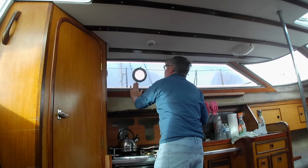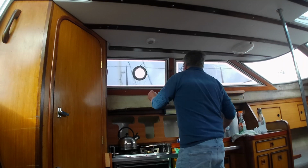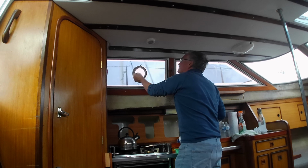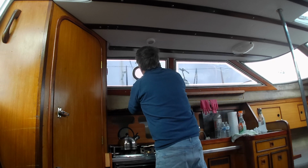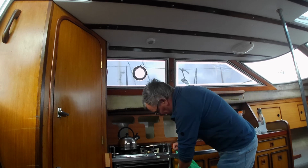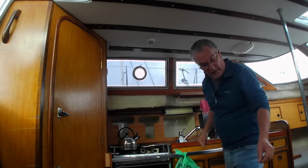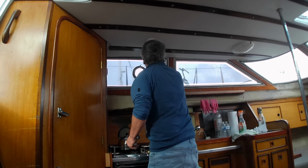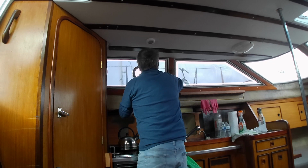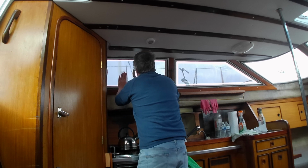Soapy water just allows the film to slide around a bit. So that took a bit of a steady hand to cut around. I just need to tease this off now. That's it. So then we can squeegee it out. And then I have to do my border trim. I'm doing a two pencil wide border trim. Why? Because that helped me eke out the amount of material I had.